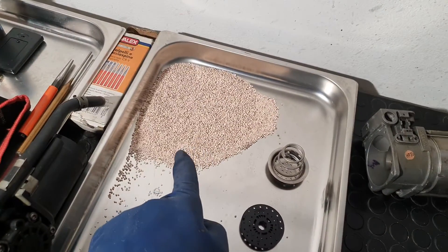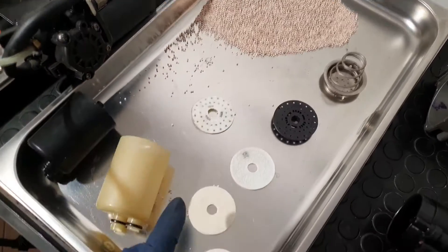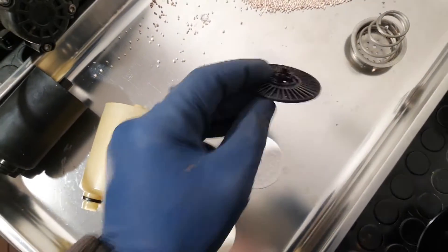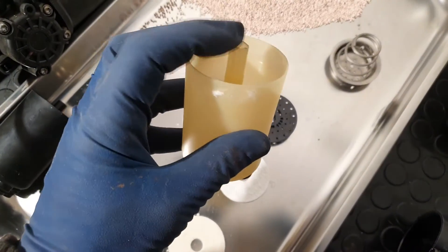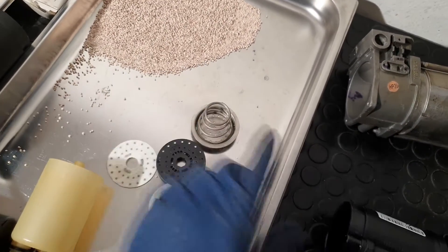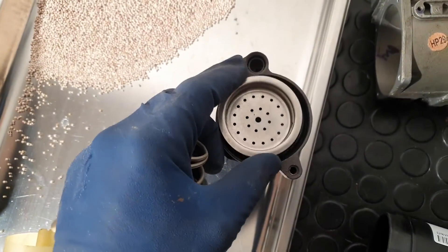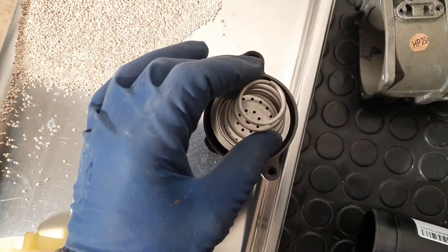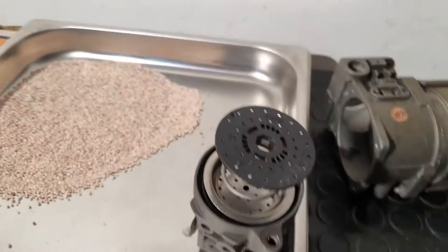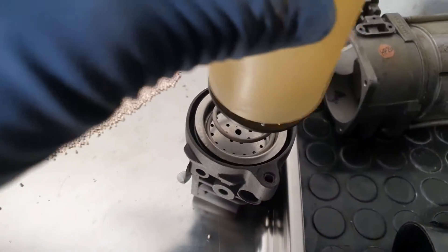Then there is the silica gel layer, and on the upper part after the first white filter and the silica gel there is another white filter. There is also a small cover that you place on the main shaft, and then a metal plate with a spring. Pay attention when disassembling all this: the metal plate sits on this side and the spring on the other side. The black plastic cover on the far end of the spring works inside the cartridge — everything sits together in this way.